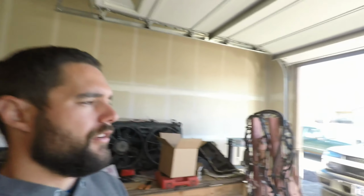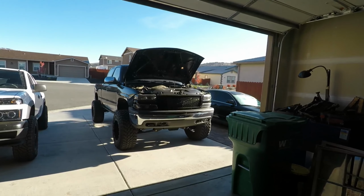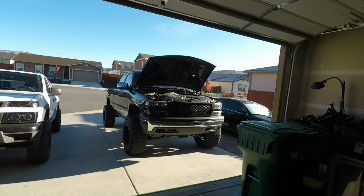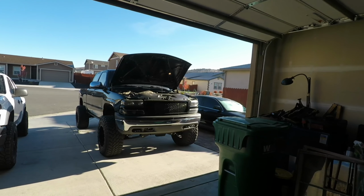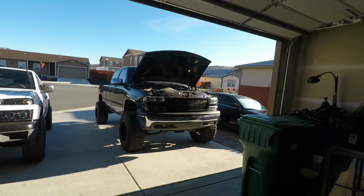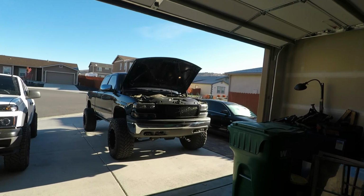Kind of a downer video today. I am having a problem with my 6.0 swap Silverado. For those of you who don't know, it's 6.0 ported heads, port intake manifold, TPSS intake, bigger injectors, headers, cam. The problem I'm having is if I give it any amount of throttle, it backfires.